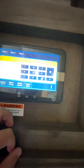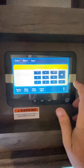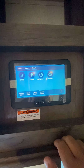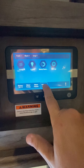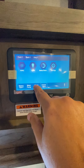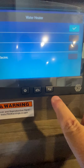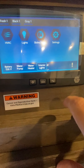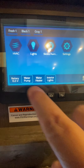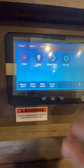The in-command — simply turn it on with the on switch there. Your default passcode is going to be all zeros — four zeros. It'll bring up the home screen. You can see interior lights are highlighted, meaning they're on. Hot water heater is off — you can do gas, electric, or gas and electric. Hit the home screen or return to go back. Water pump — you can see it's now on because it's highlighted; we'll turn that off. It also gives you the battery status.